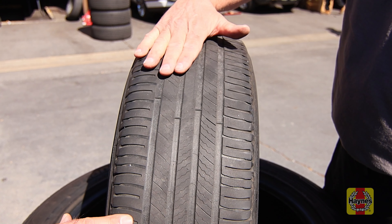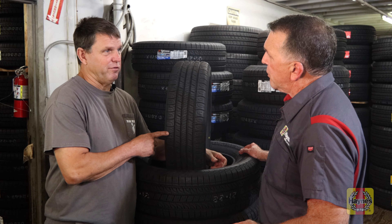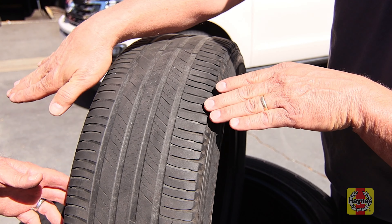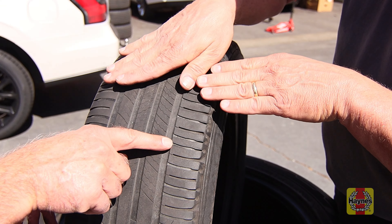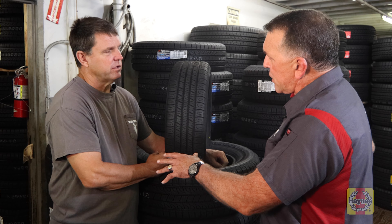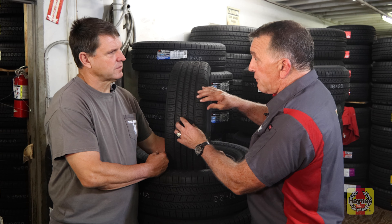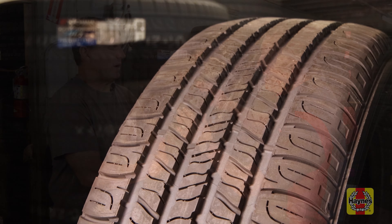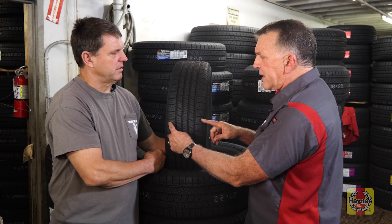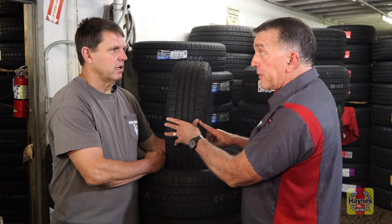When we go across the tire tread, it should wear uniformly. Our main goal is to keep it wearing uniformly. If you're getting wear on both outside shoulders of the tire, you're underinflated — the center is sinking and you're wearing on the shoulders. You could also have outside wear if you take turns fast, and still have the right tire pressure.